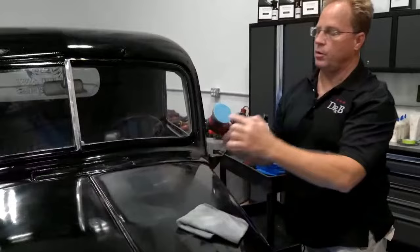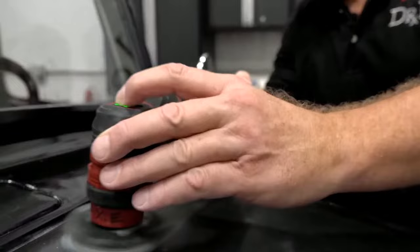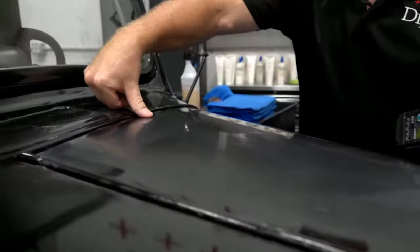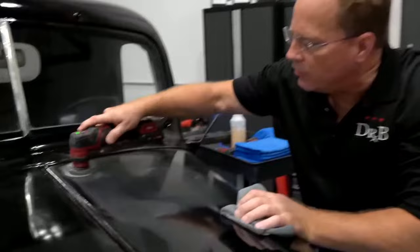And then it's going to come back here, bump this up to the 4. Okay, I'm going to call that good. And notice I'm still about a thumbnail distance away, but I've wavered a little bit closer. So that's going to smooth that orange peel line over. There's that technical word, that's a technical term. Now I'm going to finish this line up here, back up to the 4.